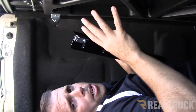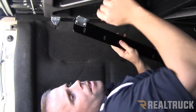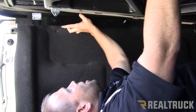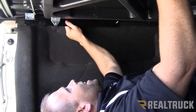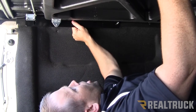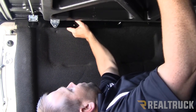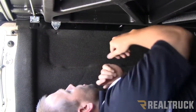We've got the whole front of the cover done now. Moving to the back brackets, which are on the inside of the bed — all we're going to do is push the cover up just a little bit, slide the bracket on, let the cover back down, and then slide the silver plate to where it's right in the center of the steel rod. Then let it back down and put your clamps on.